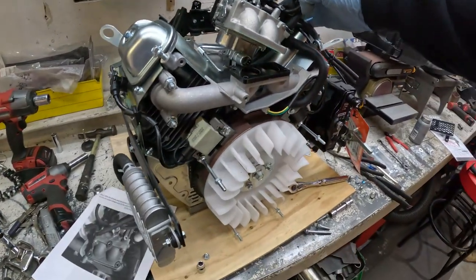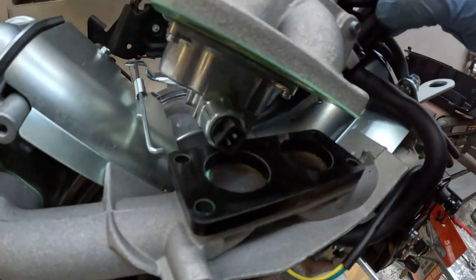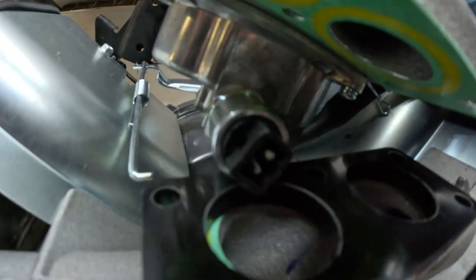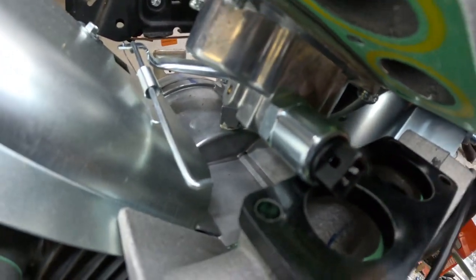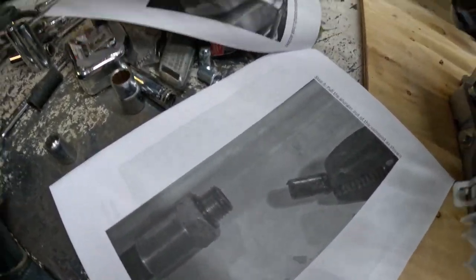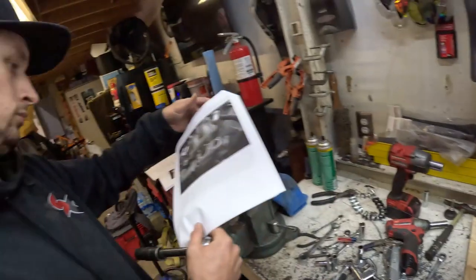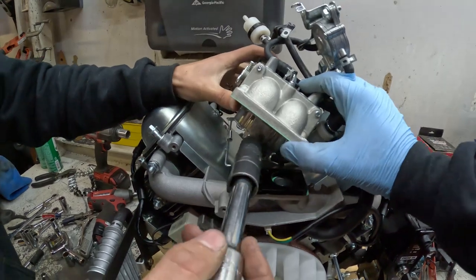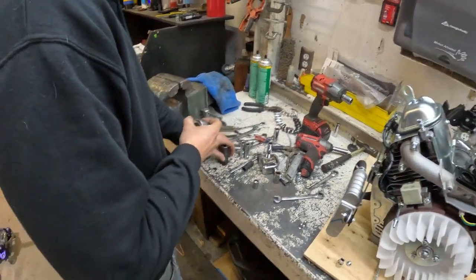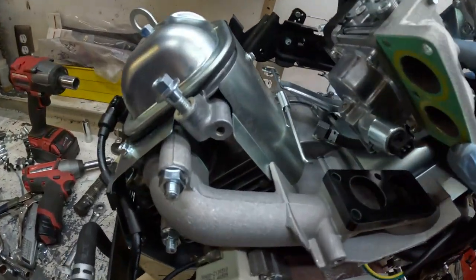We're knee-deep in tearing apart a brand new motor. That thing is called the solenoid — there's a solenoid right there with a little plunger in it. We tear it apart and pull that plunger completely out. It's the fuel solenoid. We've got to do it for more power, and it also says it'll shut the motor down if you go up hills, which we definitely don't want.